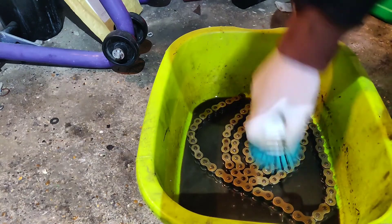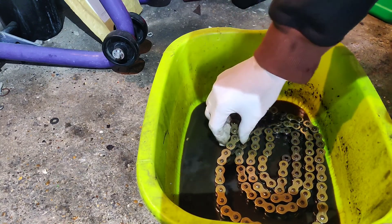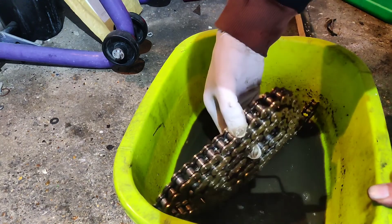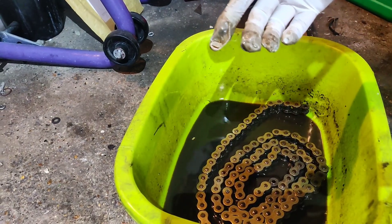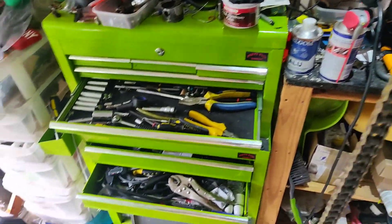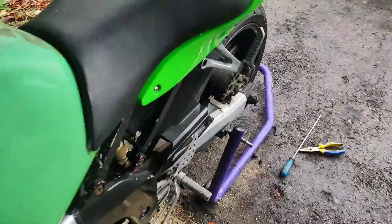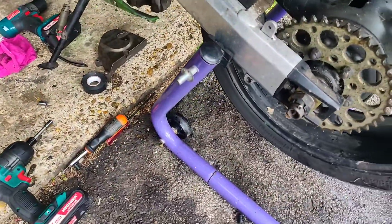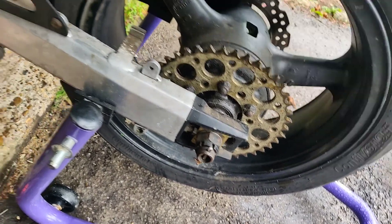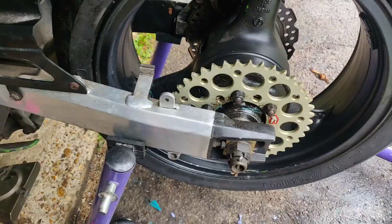Look at that — that's a couple of minutes — nice. That edge is done anyway, so I'm going to work my way through it on to the side. So there we go, the chain's looking a damn sight better. I've just dried it off and I'll give it some fresh oil before it goes back on — just leaving it to dry and let the fuel evaporate off. I'm going to do the same with the rear cog now. It's just grotty — there's nothing wrong with it, the teeth are pretty good — and the front sprocket ditto. No requirement to change, just get it cleaned up.